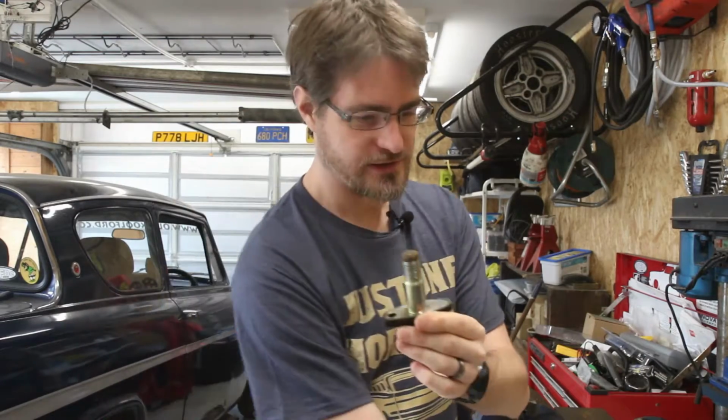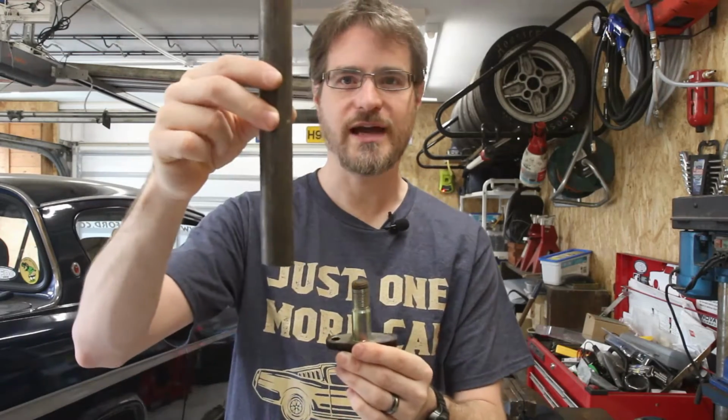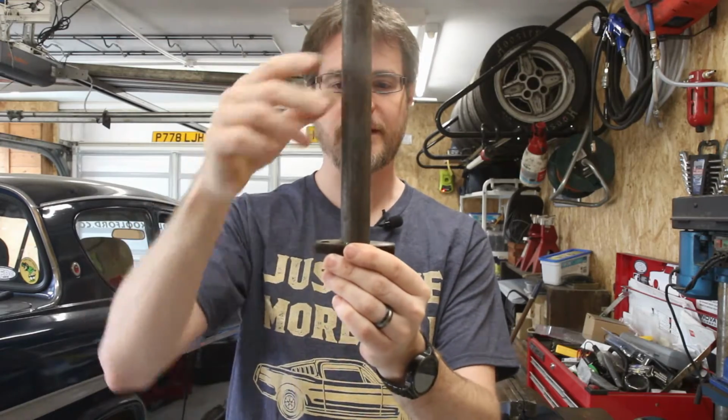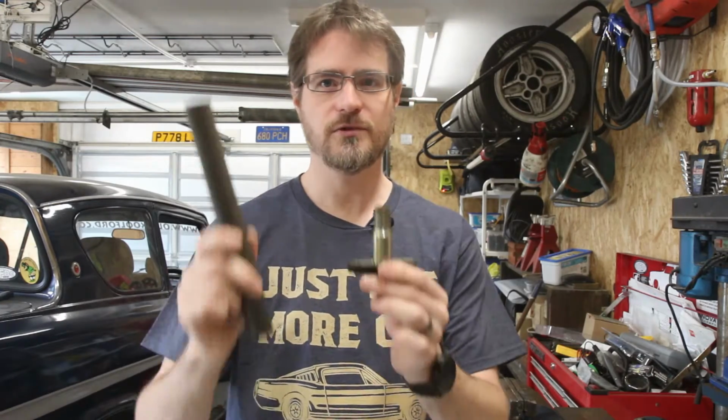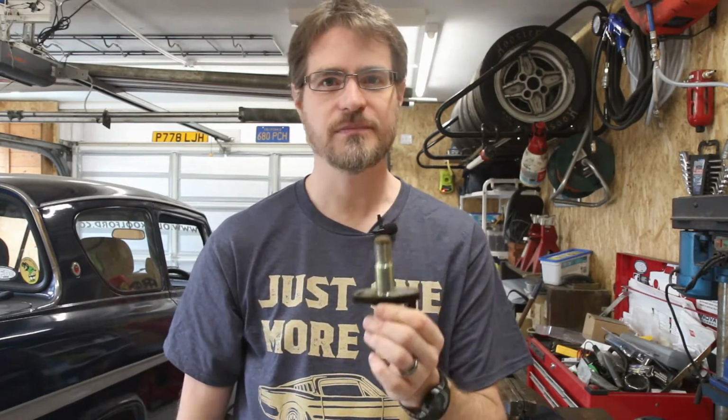Luckily, the size of this just so happens to be just about the right size for this bit of nice big thick wall tube, which is what I'm using for all the rest of the suspension components. So with a combination of these two, I think that we can modify the rear hubs and get a working decent handbrake. So first thing to do is pull the hubs off the car, so disconnect them from all the suspension arms and get it on the bench and start chopping it.